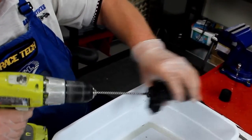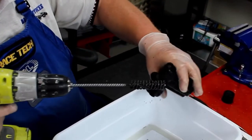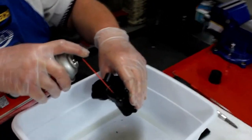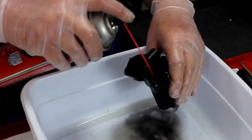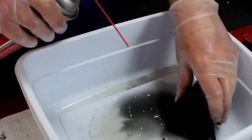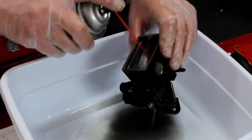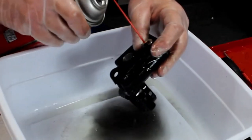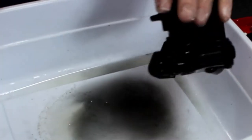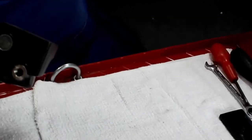It's often easier to do this in a vise. The older and rougher condition the bore is in, the more honing will be required — in this case, not much. This unit's in pretty good shape compared to many that I see. Notice I'm spraying back through all the ports here — I want to make sure I relieve all the dirt and gunk. The last thing we want is a whole bunch of debris in there with our brand new seal set.